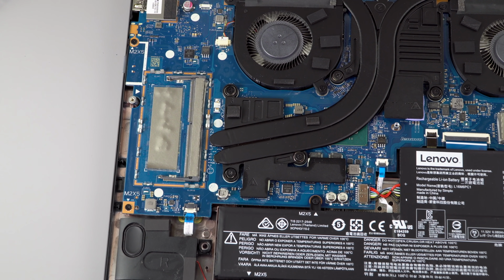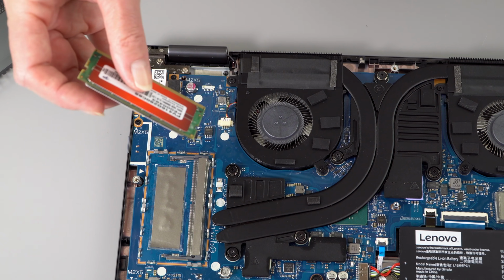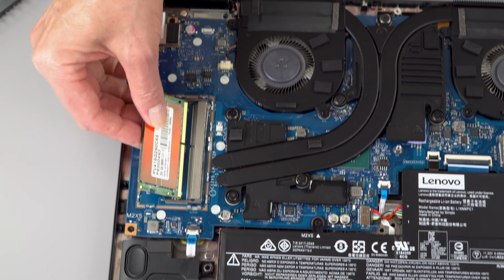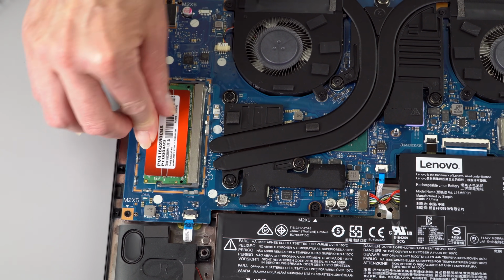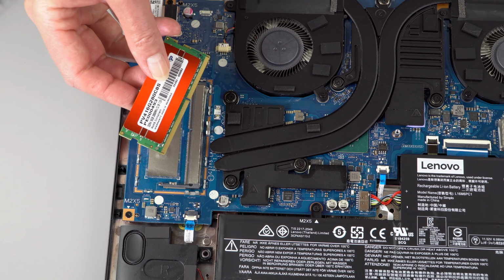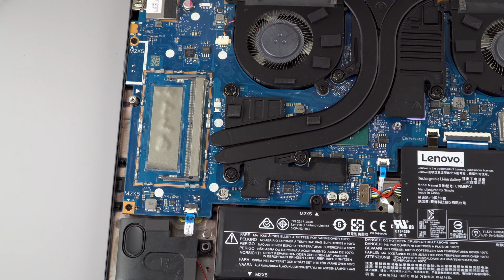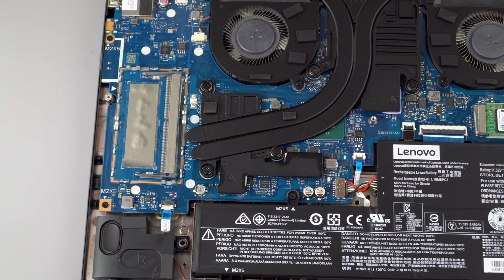Now, what if you want to go up to an oddball 24 gigs? Because that would be possible with the 16 gig module. Here's a module I have right here. It's a Viper. It's slightly high performance. It's got little heat sinks on here, and it's a little too thick to go in there, which doesn't happen that often, but it won't go in and actually clamp in. This is a double-sided module. We got chips on both sides, which is pretty common with 16 gigs. So you'd have to find one that's thin enough if you wanted to go up to 24 gigs of RAM. Probably most people aren't going to do that anyway. So there you have it.